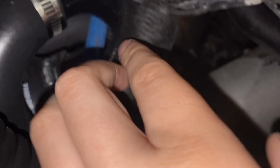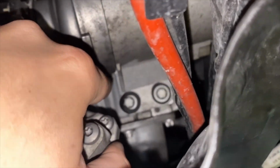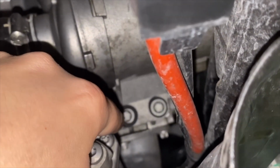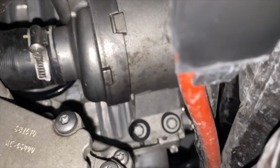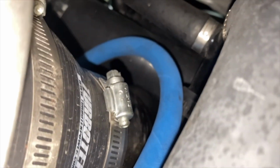Coolant lines, so this line comes off the pipe I showed you right before. So this comes off the pipe that goes through the block and connects into the elbow that connects to the water pump. Now the water pump, a lot of people ask me how I put my water pump on. It's just bolted on top of the engine block. We remove the factory bracket, and since it bolts like an N55 E-chassis car, which uses the bolts on the engine block to bolt the water pump, we remove the bracket and just bolt it straight into the engine block. It gives a lot of clearance for the coolant, for the intake pipe, and it makes it much easier for the install.